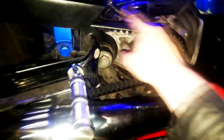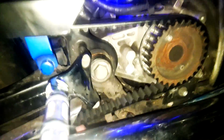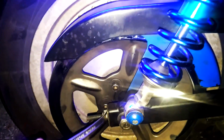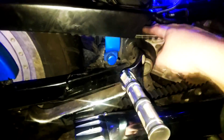Obviously at these speeds it's not gonna jump, but maybe it's too tight. I don't know. It feels as tight as the other belt. Maybe not as tight. Maybe we can loosen it off a little bit. We can always tighten it later. So how about a half quarter turn? How about just going half down? Like this maybe, there we go. And it feels tight, it's springy, it's not staying in one spot, so there's some deflection, there's flex.